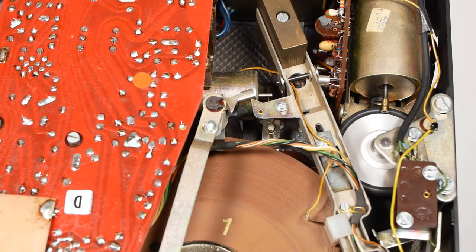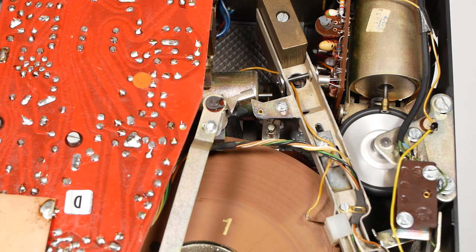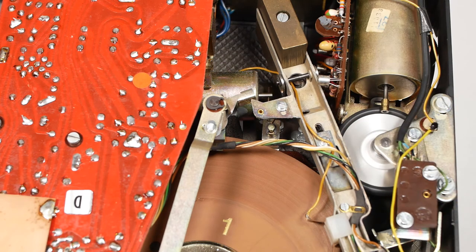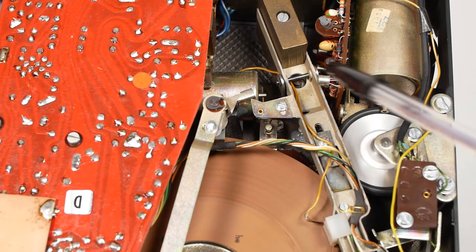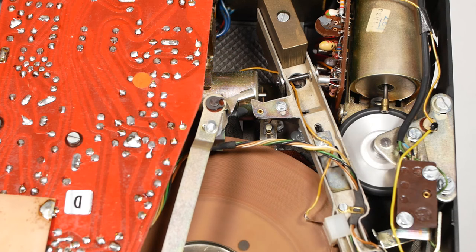OK, I've now got the machine powered, and you'll see that the motor is spinning the whole time, along with the drive wheel beneath it, but no drive is getting to the disc itself. When I put it into play, you'll see the solenoid down here will move a lever which will engage a drive roller with the disc, like that. And then when I press the rewind button, you'll see the solenoid move the other way to engage the reversing drive wheel, thusly.